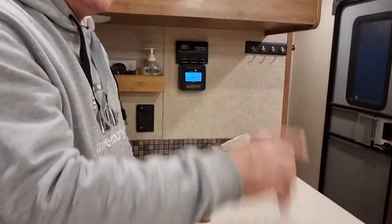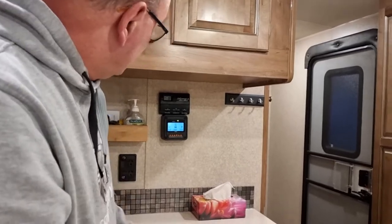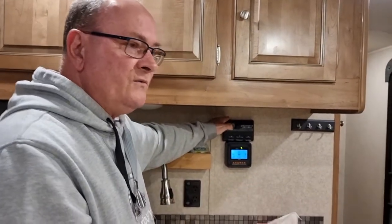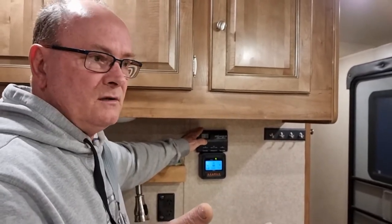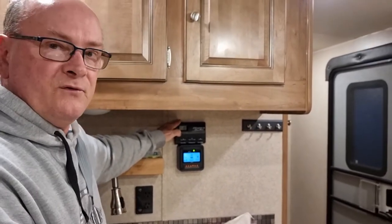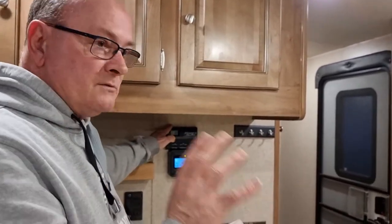Running on 12 volt, we never really flattened the batteries at all. It's still a pretty good system for the mediocre user. If you're full-timing and doing a lot of boondocking, I'd suggest upping your battery storage — that way you can utilize more of the solar when the batteries are full and you've still got heaps of sun. It's about storage, not so much about the panels. Being able to charge all that up in the given time of sun.